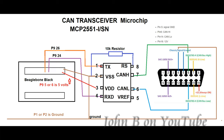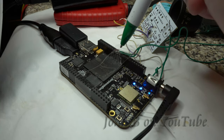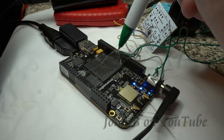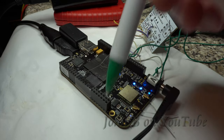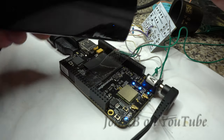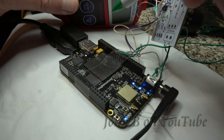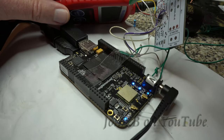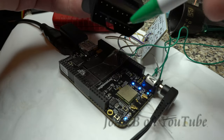I'll show you the wiring. As you can see from the wiring diagram, I've got the transmit and receive wired up to P9.24 and P9.26. The 5 volts is wired to the back of this connector, but there are 5V pins available if you check the wiring diagram. I've got this wired to a battery to demonstrate on the car, and I'm using this cheap Maxi Scan to interface the CAN high and CAN low wiring to the CAN high and CAN low pins on here.